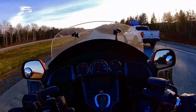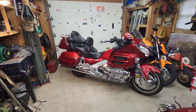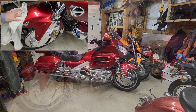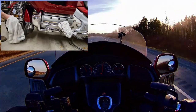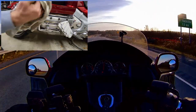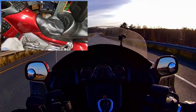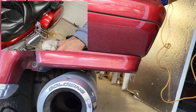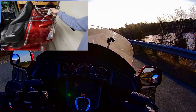It might be difficult to believe, but this bike is quite easy to keep clean. The parts that would be harder to clean on naked bikes, like the engine, are mostly hidden behind smooth plastic. So far, I've only had to wash this bike about once a year. After I wash it, I cover most surfaces with SC1 silicone spray, which sparkles for weeks and makes it very easy to wipe away dirt or bugs with a soft cloth. After any ride of moderate distance, there'll be a layer of dust down low on the saddlebags and rear fender, but I can wipe down the entire bike in about 10 minutes and it will look like it has just been washed.